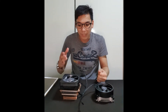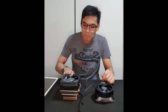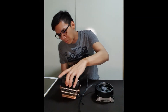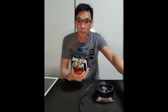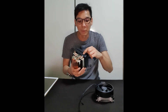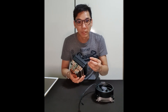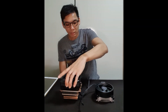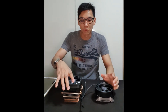In terms of lighting, the Wraith Stealth does not come with any RGB lighting. The Wraith Prism has addressable RGB and bundles two cables — one connects to an RGB header on your motherboard, and another connects via USB, so if your motherboard doesn't have an RGB plug you can still create a simple lighting effect. Both coolers come with a standard 4-pin PWM fan header, so no issues there.